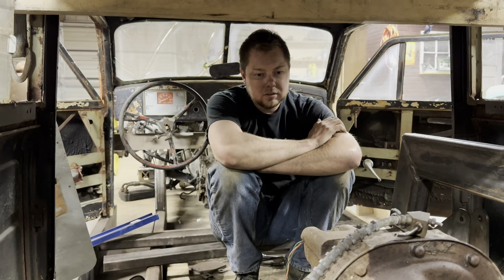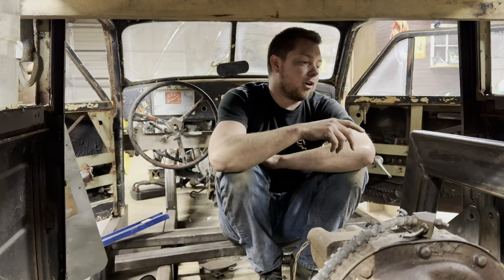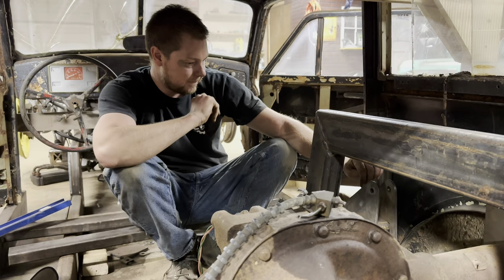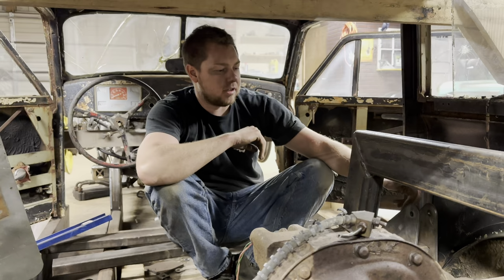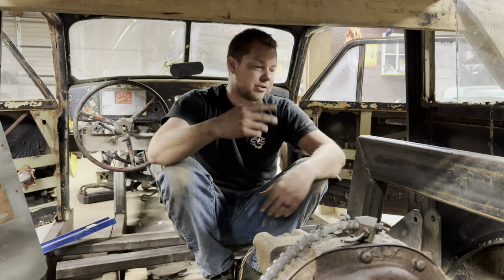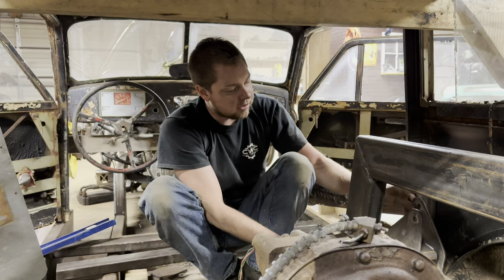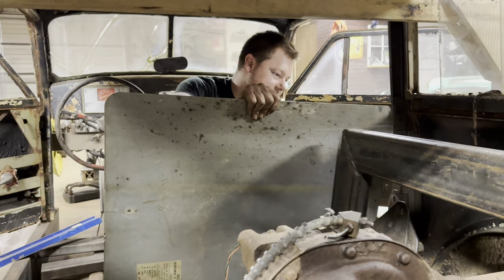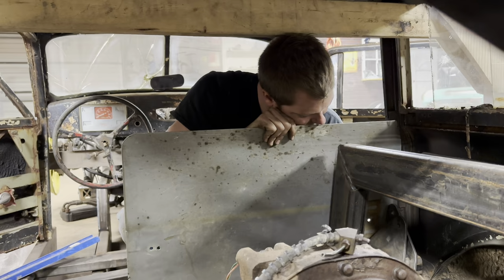So really what we need now is different control arms, or I thought about making this bracket come up a little further, this one, so then it brings the control arm back here a little bit more. That would still be getting into the metal. Well, you can cut the sheet metal back a couple inches, because the sheet metal will be here. Or just use what we got. If we turn these around, you could get longer control arms, but then the piece of sheet metal runs into the bracket. Or does it? At that angle, it does. Yeah, and then you got a big triangle there.